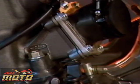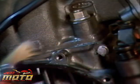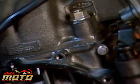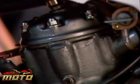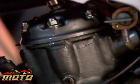Next, check the reed cage. Over-torquing these bolts can distort the cage and cause it to leak air. Then the cylinder base gasket. Next, the cylinder head gasket. Nothing suspicious here. And fifth, the gasket where the crankcase halves mate. This isn't too common, but it can happen.